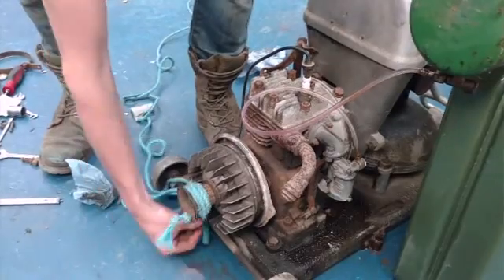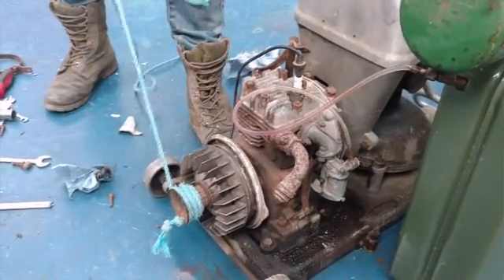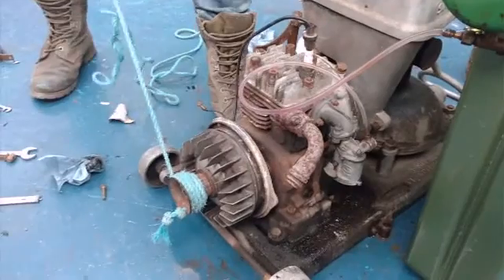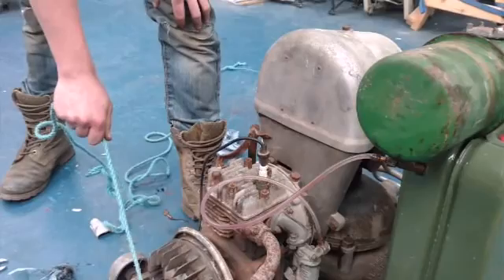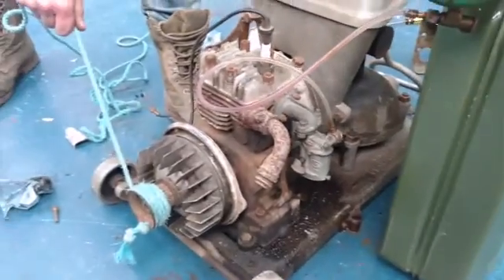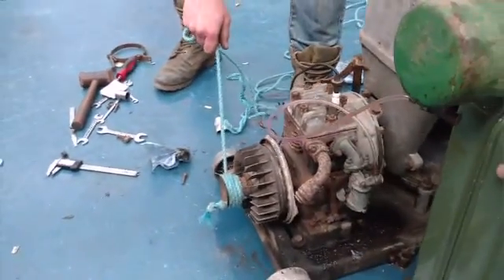Obviously the cowlings aren't back on, but we want to know if we've done the right thing with the timing and all that. We've cleaned the fuel tank out, got a bit of temporary fuel line on there, set the timing, cleaned the points. Other than that this engine has not been touched in 25 years, and I can quite believe it by all the shit on it. The float bowl was full of rust. Give it a pull over, Ash.